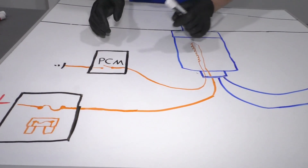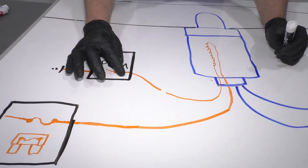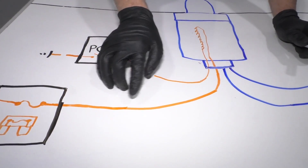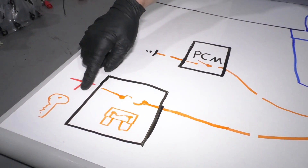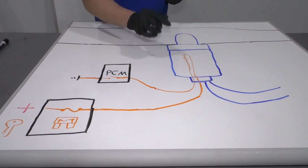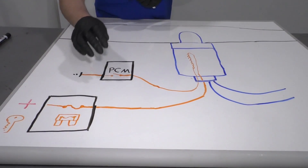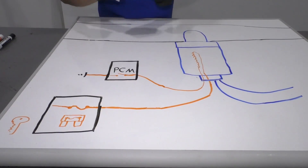A couple of other scenarios: if you tested the PCM circuit and it didn't work, somewhere in the wiring could be a break, or somewhere internal in the PCM could be a break, or even after the PCM there could be a break in a wire. On the power side, if that didn't test properly, somewhere in the wire could be broken, you could have a blown fuse, or there could be something wrong with the power getting to the fuse box. Also, if you had all four heater circuit control codes, it's probably not that you need four O2 sensors — there's probably something else going on. For instance, if you have an aftermarket remote starter system, it may not be powering up the circuits to turn this on, and that'll give you a code.